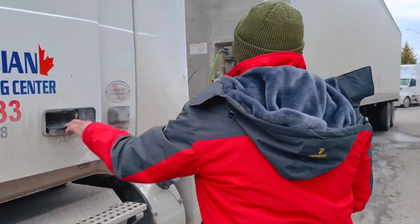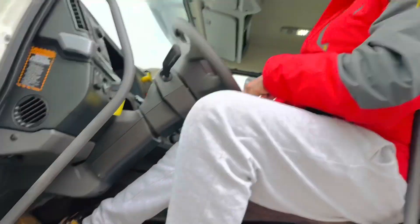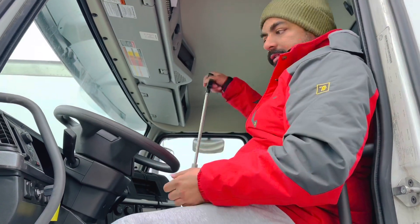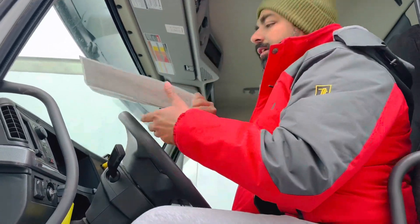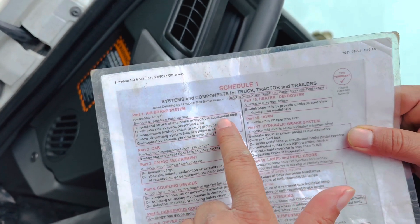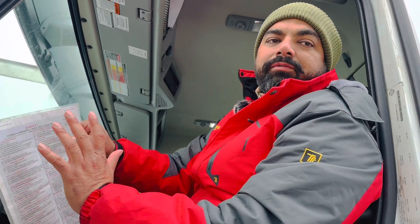To finish: put your feet on the brake first, then loosen the steering, take the stick out, apply the brakes, and set the steering as you like. According to Schedule 1, a push rod stroke of any brake exceeding the adjustment limit is a major defect — you would call the operator, put it in the inspection book, and cannot drive. Thank you very much.